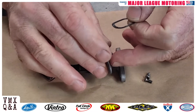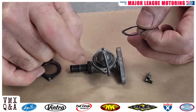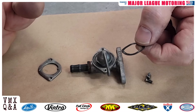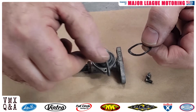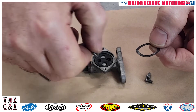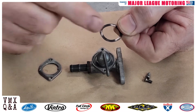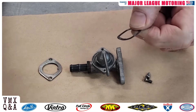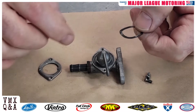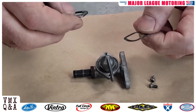You can see it sometimes — gas might drip right out of the front of the handle right here. So next time you have your petcock apart and you want to make sure it doesn't leak anymore, you probably want to replace that little rubber gasket down in there. But when you do, take a look at this wave washer and make sure it's in good condition and it's putting pressure like a spring on this cap to keep this handle tied to that diaphragm.